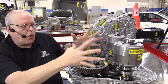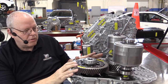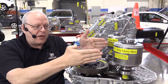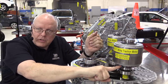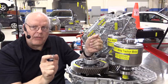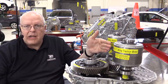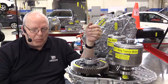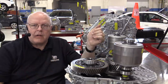But while we have the rotors here and the gears, which I told you I have a separate video on how the gear train works and power flow, electrically, we need to synchronize the electromagnetic fields of the stator with the magnetic poles of the permanent magnets that are already inside of this rotor. And we do that by watching this cam lobe rotor resolver down there. We need to synchronize the electromagnetic fields just perfectly with the magnets here on the rotor. And this is called a synchronous AC, for alternating current, motor. What's synchronous about it? Well, I just said we have to synchronize the pulses of the external magnetic field, like that magnet I was showing you, with the magnets here in the rotor to make it rotate.